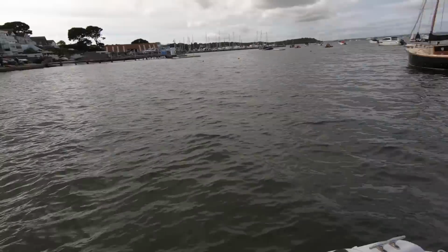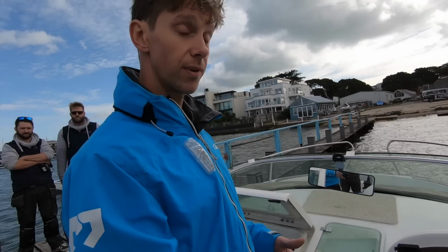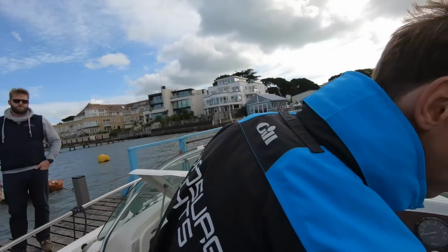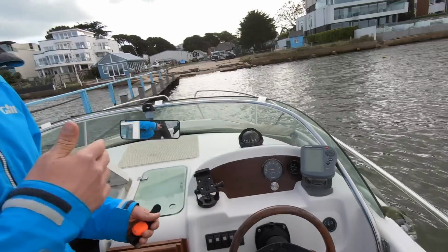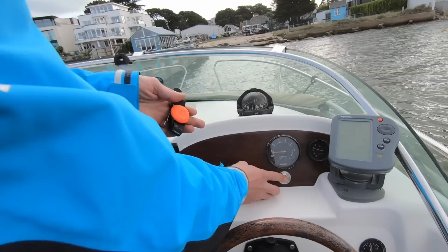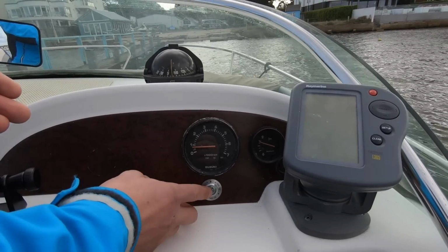Yeah, cooling water stopped, engine's off. You get a beeping from the Guardian. So after 5 seconds, anyone remaining on the boat can then start the engine again. So you would start the ignition, you can go and perform the rescue, get the person back on board. Once the tag is back on board, press the button, that puts it into a pause state, so it's still beeping, but now I've got this back on board, you press it once again.